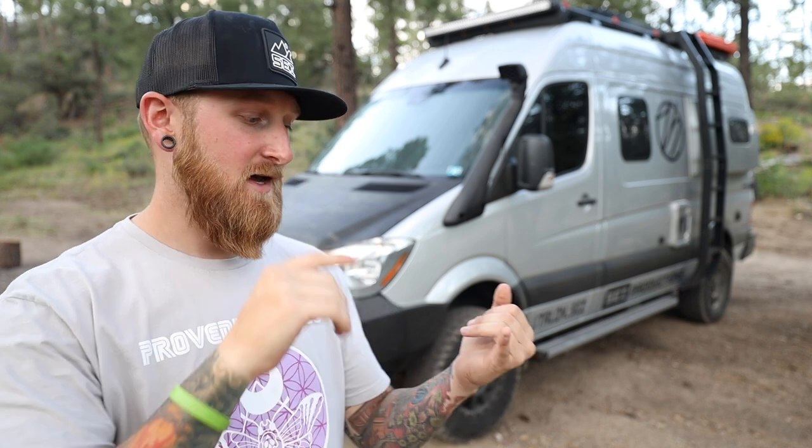There's a ton of misinformation out there on forums, Facebook pages, and different places on the internet about AC units — whether it's in a van, trailer, RV, whatever. We're going to squash some of that right now. The very first thing: just because you have an AC on your van does not mean it is going to be as cool as a house. A rigid structure with really good insulation and great insulation on the windows — you can't set an unrealistic expectation. There are a lot of different factors: the power system, the AC unit itself whether it's 120V or 12V, and the actual insulation level of the van.